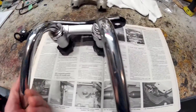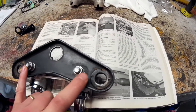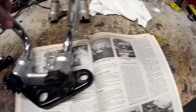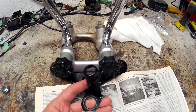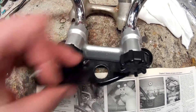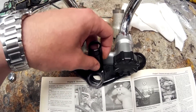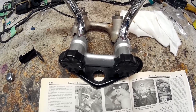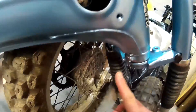Here's the old one, which was no good. I bought new handlebars and they came with this bracket, but the problem is the bolts are not the same width as the old one, so I had to notch out the inside a little bit. No big deal, I got it to fit. But now I'm running into another problem - this bracket here, the one that the light goes inside and indicates your turn signals. It won't really fit because of this little tab right here; I have to grind those down so it sits flush against the backside.